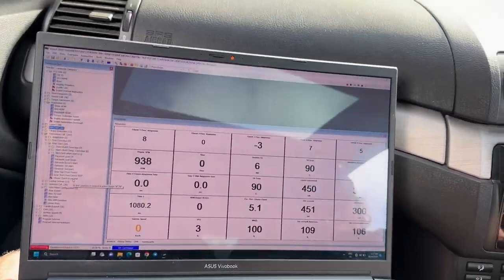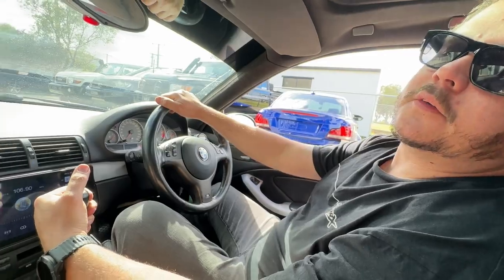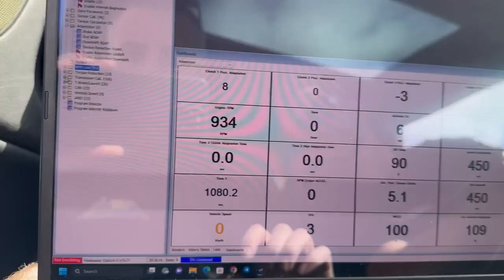Okay, so what's the process to calibrate the clutch sensor? Obviously, if you buy the clutch emulator kit from us, we provide the Haltech linear potentiometer. That is the first thing you need to calibrate. Yep, so basically what you do is you install it on your clutch pedal, on the lever, on something so it can move in and out as it does, and then in the Lamik software, you go to the setting, which Andrew will show you here.